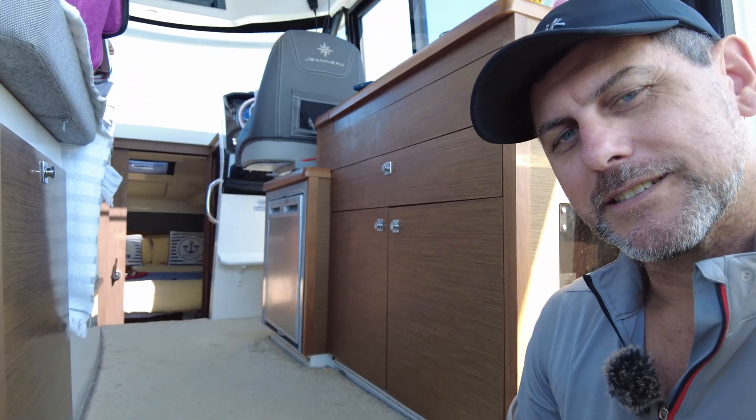All in all, I'm pretty happy with how everything's going. We were just out overnight and we used about 40 amp hours — actually, we had 85% left, which was about 39 amp hours. So we used about 15% of the battery overnight. We've just driven back down again, and even only driving about half an hour, we have recharged the batteries fully. I had a look when we were driving and we were pushing in about 35 amps, which is a lot more than we used to. Very happy. I want these ones to last a long time — they cost a little bit. If you've got any questions, leave them in the comments down below and we'll see you next time on the rudder.